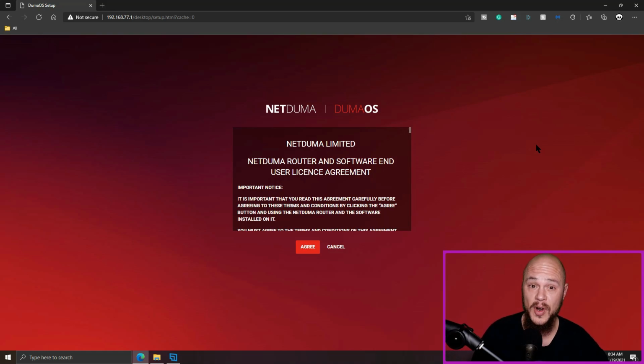Welcome to a fresh firmware install of firmware version 3.0.394. Of course, we're going to go through how I like to set everything up on a fresh firmware. Make sure after installing firmware and getting to the dashboard the first time on any router to factory reset. I actually like to do this twice. Granted, it adds a couple more minutes to the overall process, but if you don't factory reset at least once, you can run into old issues, and that's the last thing you want.